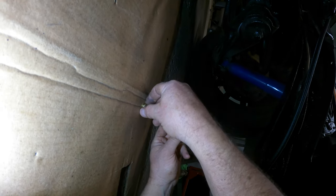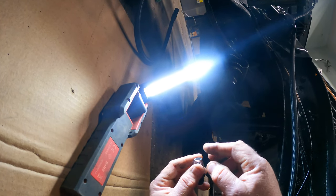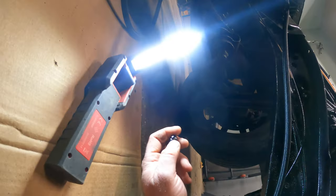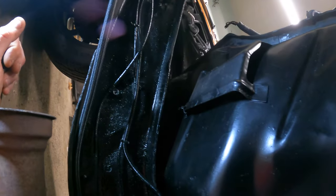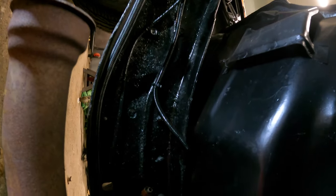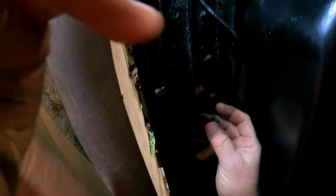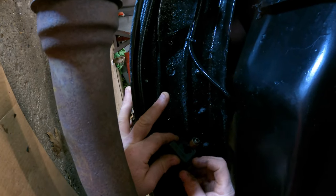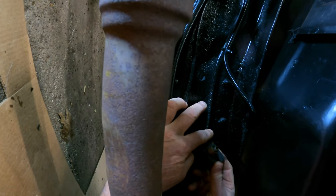That there is a quarter inch, not three-eighths. So I just ordered two fittings and I don't need either one. I've got to go through the rad with this too, so I'm going to need four of these quarter-inch fittings so I can make a bypass for the rad and still be a 6AN fitting. My rad — I bought a tranny cooler that's 6AN too. But I want to go through the rad as well, because I was told if I don't, there's a possibility of frying stuff. So we don't want to be doing that. So while I'm down here, I'm about to cut this off because it's going to come off anyway. That way I'll have this fitting so I can make sure I get the right one — I can measure it. Pretty sure it's quarter inch.